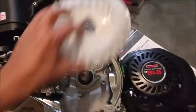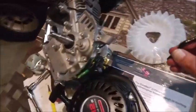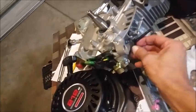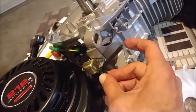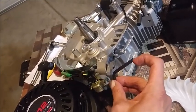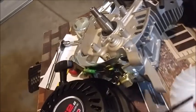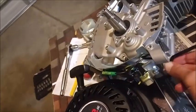I have been watching a couple of tutorials where these guys were removing the governor, and they had this guy, which, if you have any previous knowledge, sits down in this hole and goes inside the motor. One guy, I'll leave him anonymous, cut the tip off of it, the tip that sticks outside. He recommended that you cut it off with a Dremel tool. I saw another couple of folks, this guy grabbed it with a pair of pliers and basically muscled it back and forth until the tip broke off. And the reason behind that was the perception, or belief, I should say, that it needed to be broken off in order to push it through.